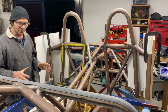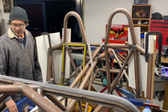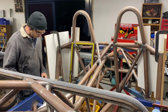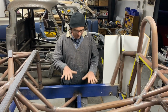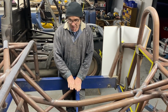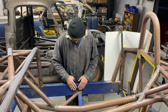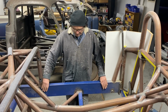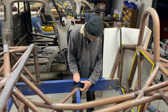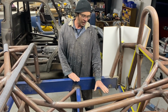One of the other huge advantages in this particular car is that you're sitting about 5 inches lower in the car than a standard C1. The reason we can sit so much lower is because we don't have a chassis to sit on like the original cars, where you sat on top of the chassis. What we've done is put all the structure inside the sill itself, and so, with the original floor of the car here, it's allowed literally 4 inches to the chassis and another inch or so lower to the floor.